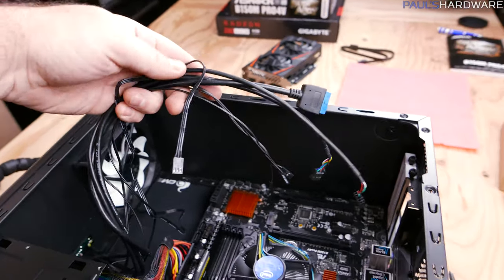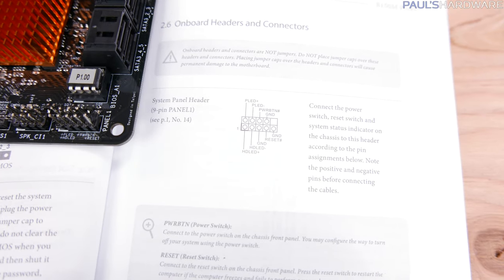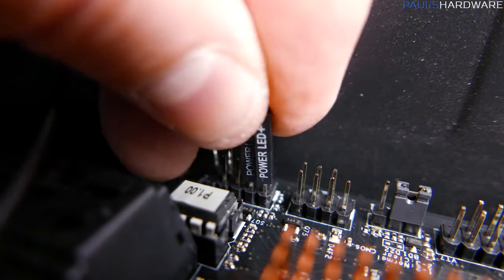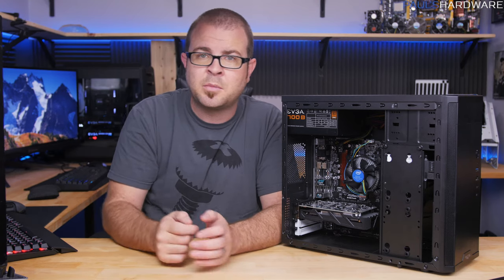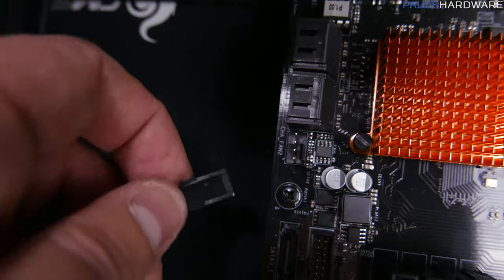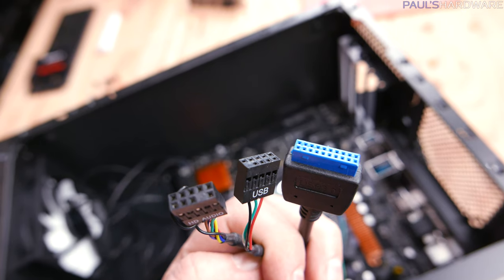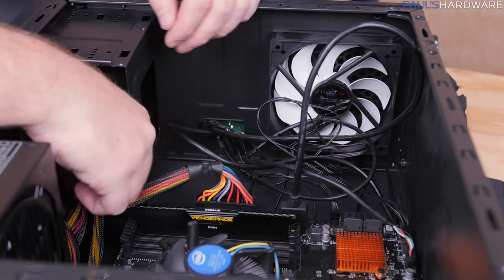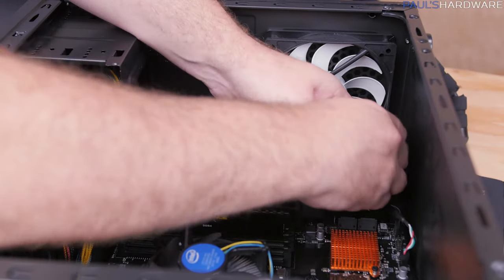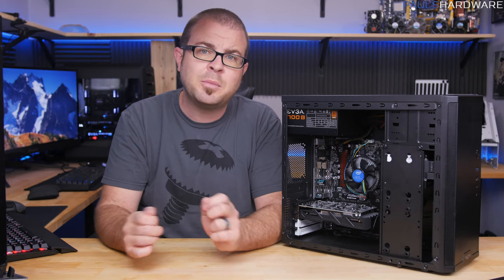The rest of these cables are front panel plugs from the case, needed so that the power button and USB ports will work. By far the most annoying are the front panel power, reset, and LED plugs, as they are tiny and they need to connect to equally tiny pinouts on the motherboard — just reference the manual to see what goes where. Remember that for the LED plugs you will need to pay attention to what's positive and negative, but for the switches like on/off, that doesn't matter. This case does not have a reset button, so those pins on the motherboard won't be used. This case has one fan with a three-pin plug that plugs into the chassis fan plug on the motherboard. Then finally you've got USB 2.0, USB 3.0, and front panel audio — the USB 2 and audio plugs are keyed differently so you can't mix them up, and each has a specific labeled spot on the motherboard. Now is a good time to tidy up some of these cables up front — try to gather them in a neat bundle with a twist tie, and keep them away from blocking that front intake fan. Make sure twist ties are in good shape with no metal showing that could cause a short.